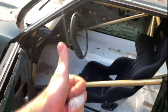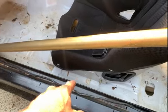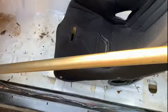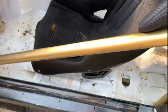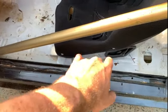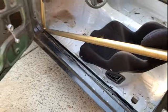As far as the interior goes, I've got this Kirkey seat that I got for a hundred dollars on Facebook. I made some seat mounts, ran some sheet metal to reinforce the floor all the way across front and back, with a little 90-degree bracket of eighth-inch aluminum bolted to it. It has two adjustments — me being six-foot-seven, it's as far back as it'll go. I'll need to do a quick release at some point so you can get in there easily.